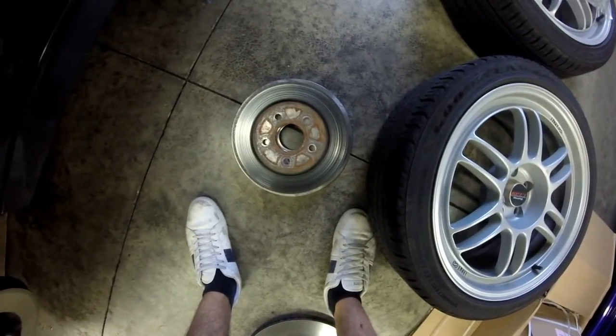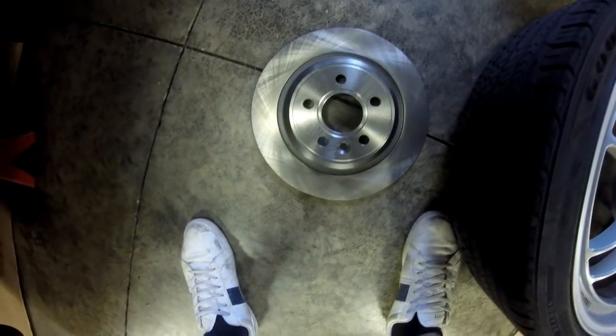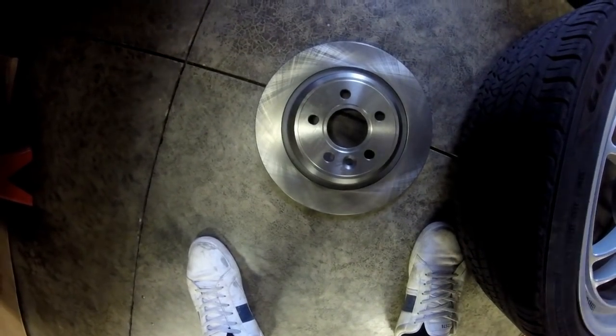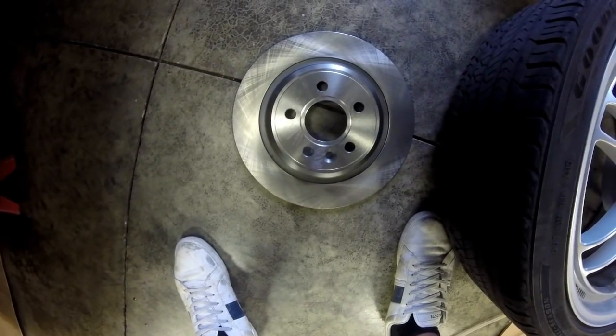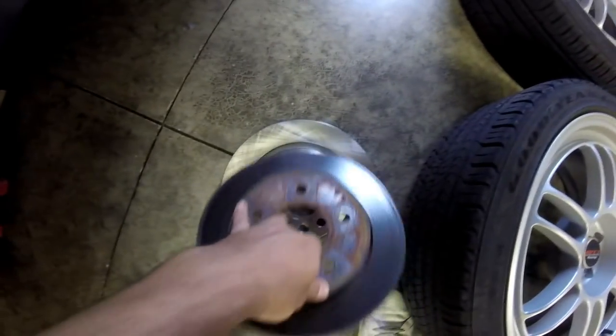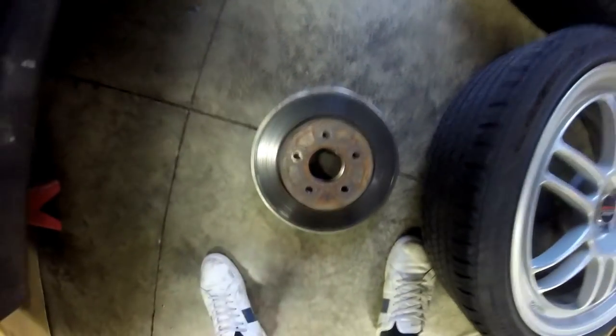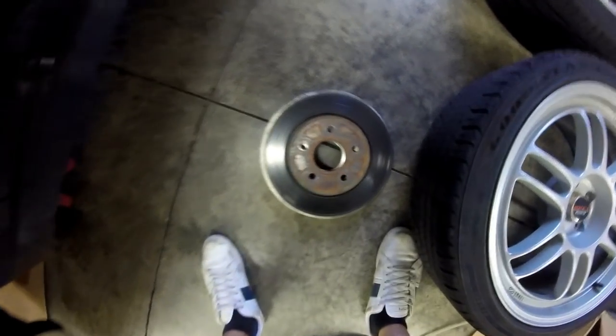Here are the rear brake rotors. Of course, here we have the stock. For some reason, mine were severely grooved and pitted, but that's besides the point. This is the new one, off of the Volvo V70, I think, or something like that. All of these minute details, I haven't looked at them in a while, so I'll be checking them out and putting them in the description below. But one thing that I definitely do remember is that this is a 270 mil rotor stock, and the Volvo one is a 302 mil rotor, so you get an extra inch.